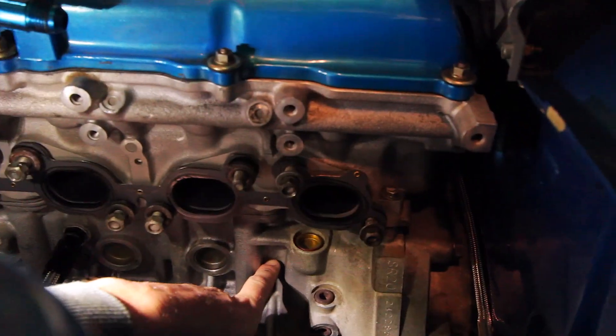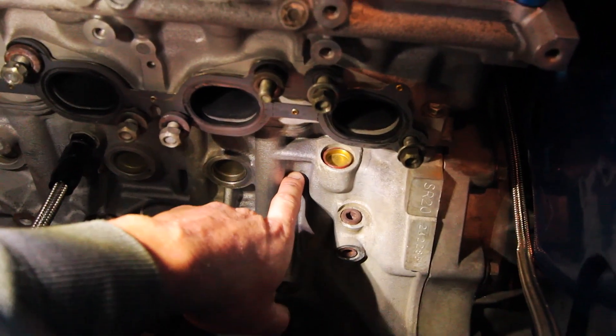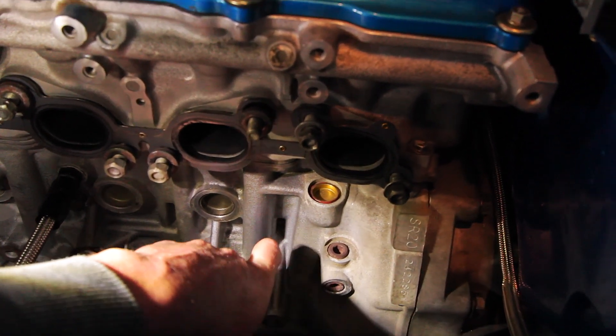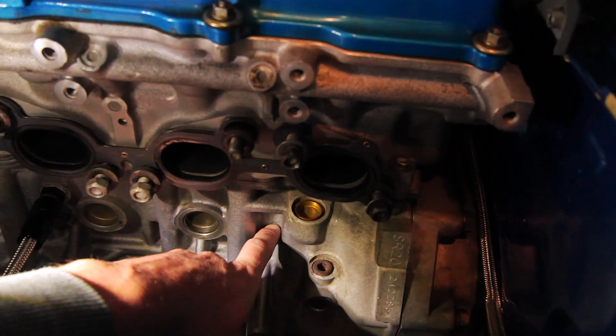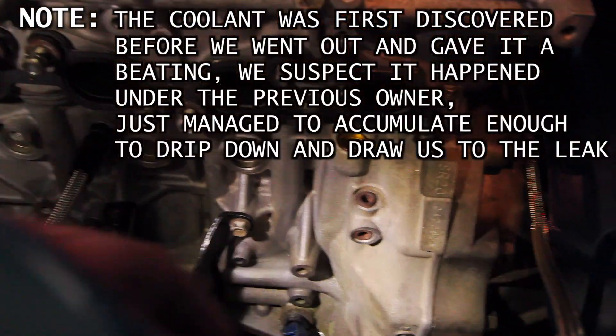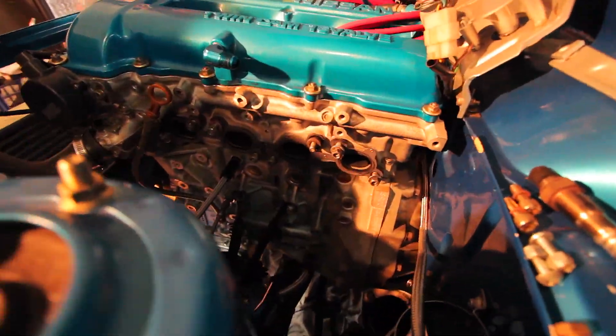You can see the coolant leak here. That was basically the indicator after we went for that drive, which you've probably already seen. There was a little spot on the floor - a little 20mm hairline crack across there which you might be able to see, probably not, but yeah, that was slowly weeping a tiny bit of coolant both when it was running and after it was turned off and cooling down.